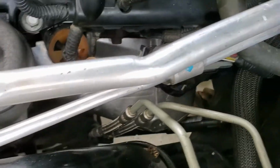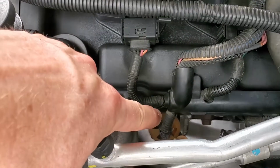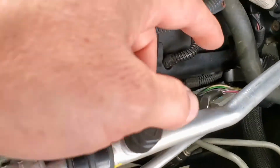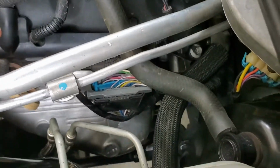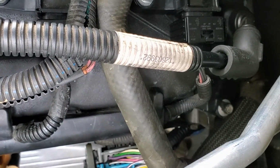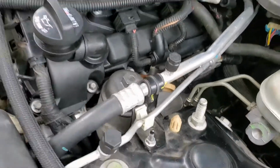This side, you're actually able to, once you get the bolts for the heat shield out, which are kind of a pain in the butt because one's down there, you've got this plug that has this insulator around it, and then the other one in the back, it's reasonably easy to get out once you take this particular wiring block loose, which is connected to the block right back there. If you loosen that bracket, you can get to that bolt pretty easily. That shield will slide out of the way, and it's pretty simple to get those out.